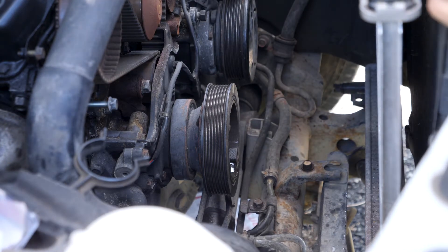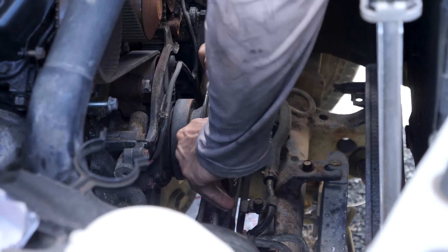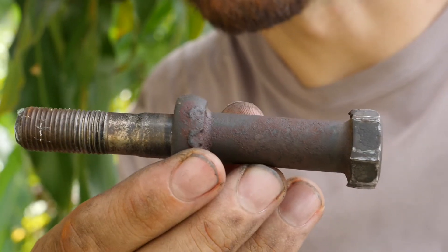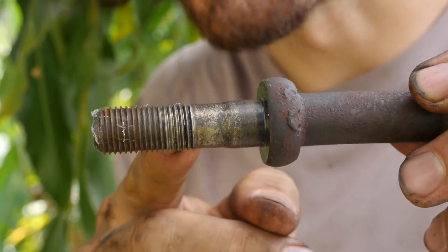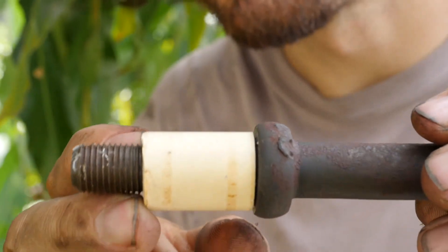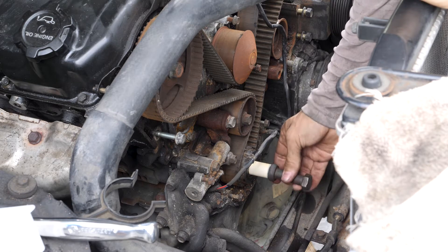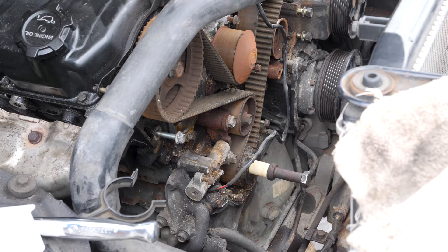Now I'm going to try and remove this crankshaft pulley. This is the crank bolt and I'm still going to need this to turn the crankshaft — I'll fit the socket on the end of this and then I can spin the crankshaft. But so that this doesn't keep threading into the crankshaft, I've made a little spacer out of half inch PVC. What that will do is just put friction on the crank so that I can spin it. Now I'm just going to thread the crank bolt back in and it will butt up against my spacer, and that way I can turn the crank to find top dead center.